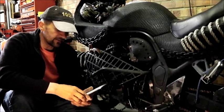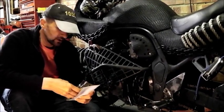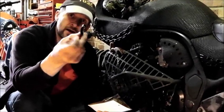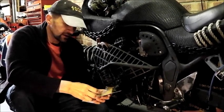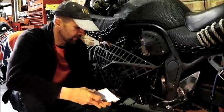This is the seal kit - it's ever so simple. It's a big fat rubber seal inside; that's the offending seal that's worn out inside the bike. So it's just a case of getting the slave cylinder off, take the seal out, put a new one in. It's as simple as that - a bit of housekeeping along the way, make sure we do a clean job of it.